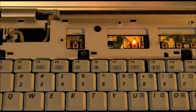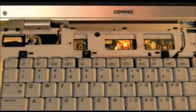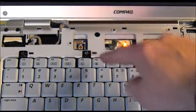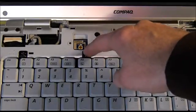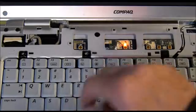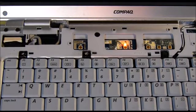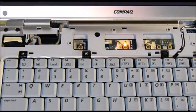One thing I will have to do — right now I have this top panel off because I had to drill out these two screws here because the heads were stripped. So what I'll have to do, once I'm sure the keyboard is still going to work fine and I give it thorough testing, I'm going to have to put some JB Weld on here in order to keep this keyboard from flopping a tiny bit on this side. I'm not worried about having to remove it again because honestly this machine's not worth fixing if I'd need any other repairs. So once I'm sure it's fine, I'll put this back cover on, JB Weld this, and we'll be good to go.